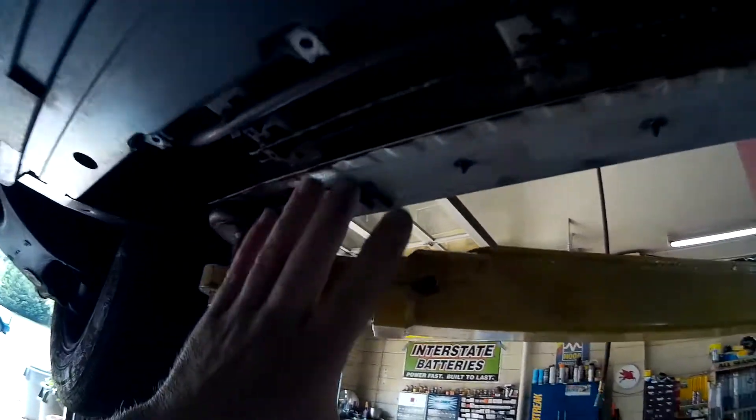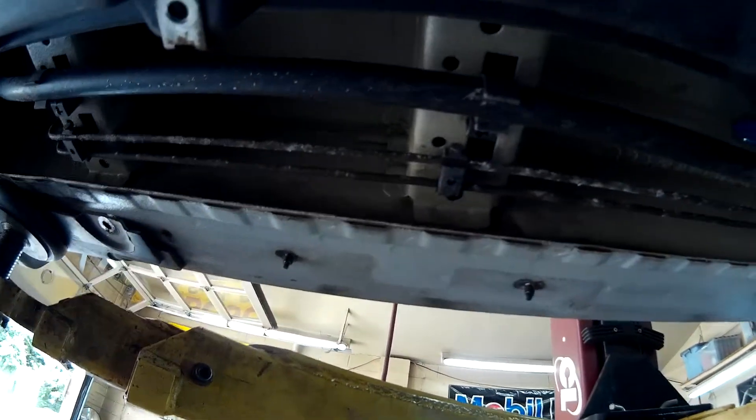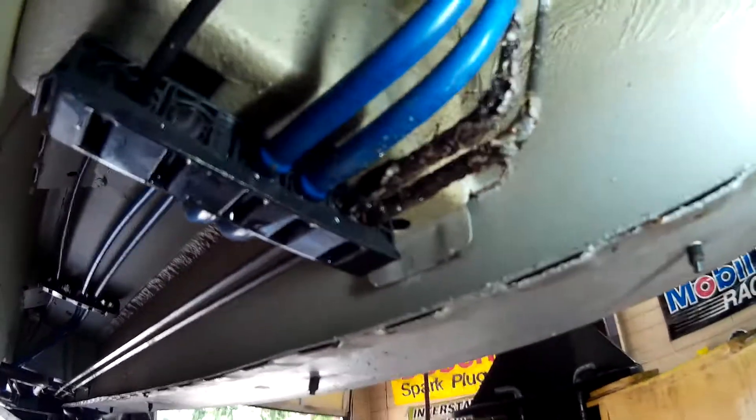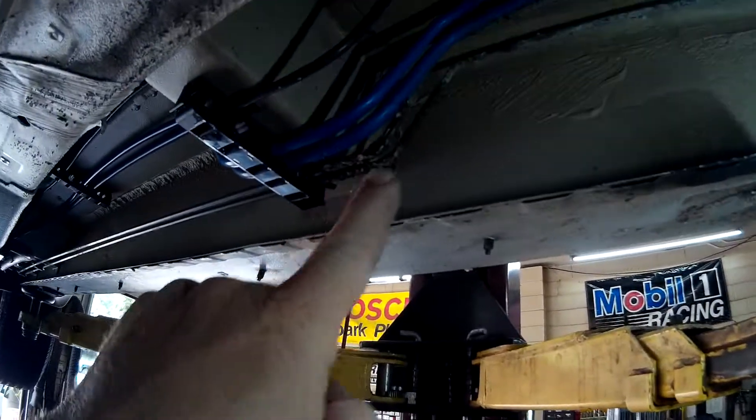I noticed that this panel here is wet with brake fluid, and that panel sits right underneath the car. So I pulled it down where it was wet — but these lines aren't wet at all; those are the two brake lines that go to the back. As I slowly worked my way farther forward, I found the culprit: these two lines right there are rotted away and seeping, then dripping down on the pan and running back.